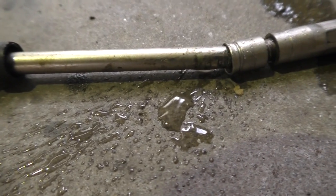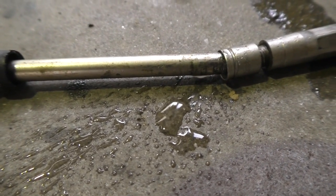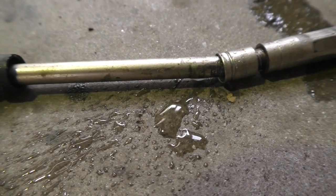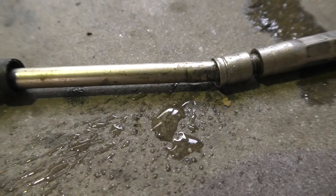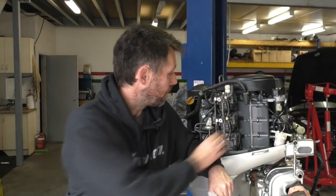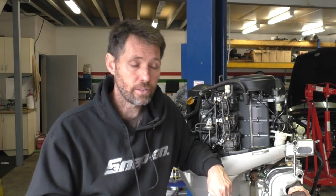Like the other cable, a bit of water came out straight away. I'm just going to leave that sitting until the oil comes through from the other end. I'm going to put these carburetors back on now — they're just resting here at the moment. I've got to put the airbox silencer on. They're a little bit fiddly to get back together because all the fuel lines sort of go around the back of them, and there are some vacuum lines and things around there too.